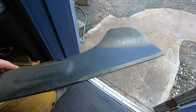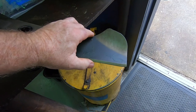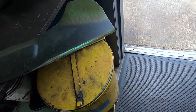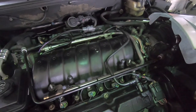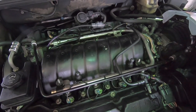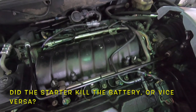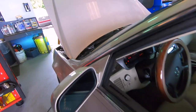Brought in my mower blades to sharpen today — they're pretty bad, haven't sharpened in about three years. I realized pretty quickly they're about as sharp as the handle of a butter knife. Kind of weird with this Cadillac — I put a battery in, had a dead battery, started a bunch of times, no problems. Took it for a road test to relearn the idle, got back, shut it off, started it one more time and the starter just kind of spun — didn't turn the engine and wouldn't stop spinning. Even when I turned the key off it kept spinning. I had to disconnect the battery. So now I put a starter in it. The Bendix is just freewheeling and the solenoid must have melted together. CarQuest starter — there you go, boom. Like a brand new car.